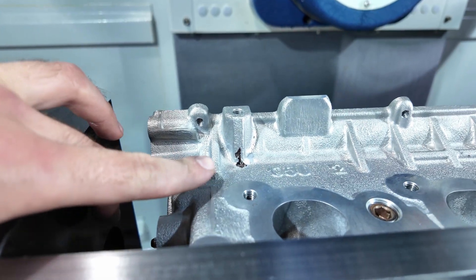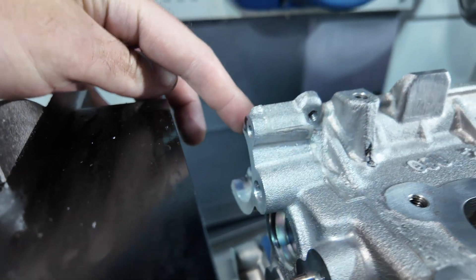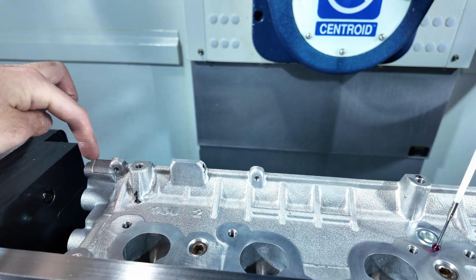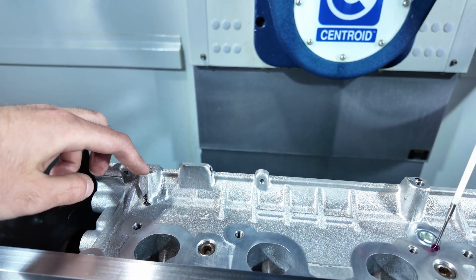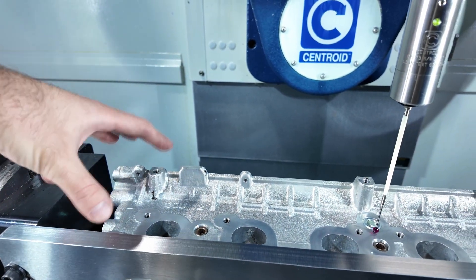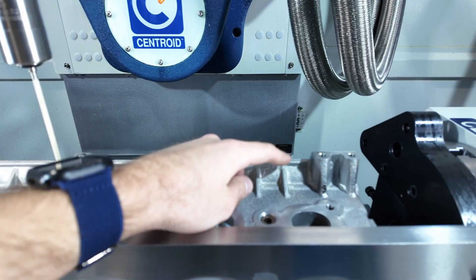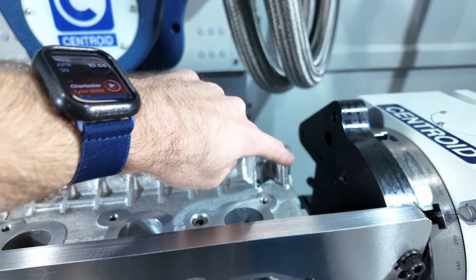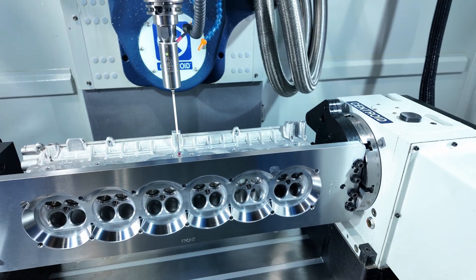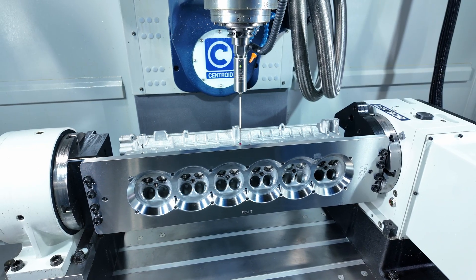You can also see I've got a couple points marked out — I have a one here, there's a one on the side of this and over here. So I'm going to take the points from all these sections, probe off this height and probably this height, and we're going to create a whole block-off section of collision geometry. I'm going to do the same for this here and for this bulk of stud holes over here — make sure that all this is programmed in the machine before we actually start digitizing so the machine knows it's there and we don't collide with it while we're digitizing.